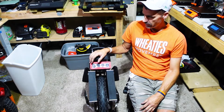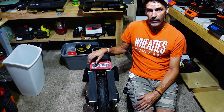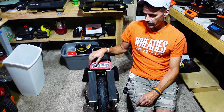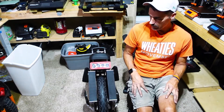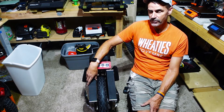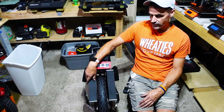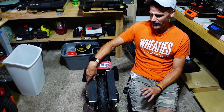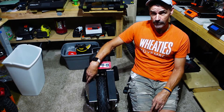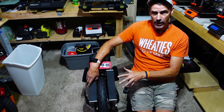Unfortunately, since we are still dealing with a hurricane, I'm not going to go out and test it right now. But I'm hoping to get some good results - everyone that has put a street tire on the EX20S has had favorable things to say about it. What I don't have quite as favorable a thing to say about is what I read as far as changing the tire. Yes, you can take it all the way apart without doing much other than removing one battery pack, but getting it back together was a challenge. Since it takes probably less than two minutes to remove one of these battery packs, I would recommend just removing the battery packs to get access to put those spacers back in. I tried to do it without removing them for 15 minutes and wasted a lot of time. Take a battery pack out of both sides when you put those spacers back in, and don't fully tighten either side until you have them both started and in there.